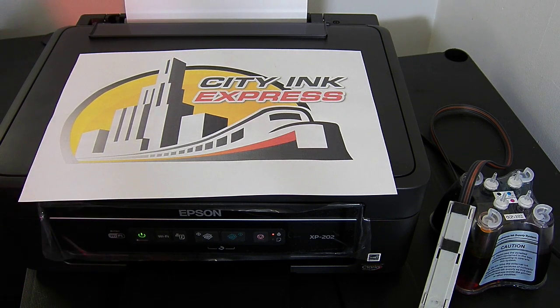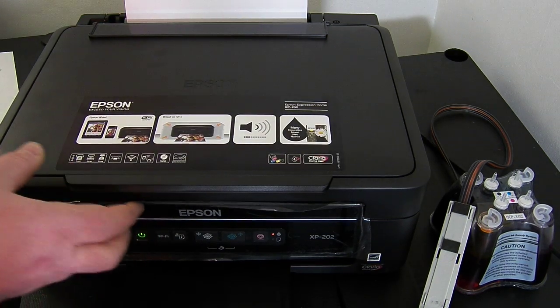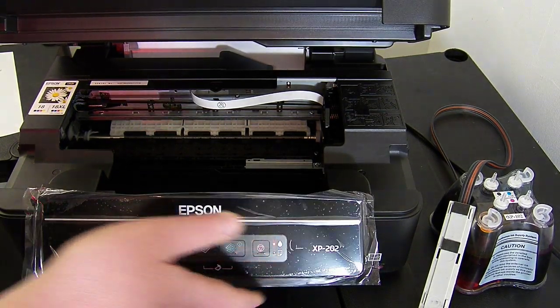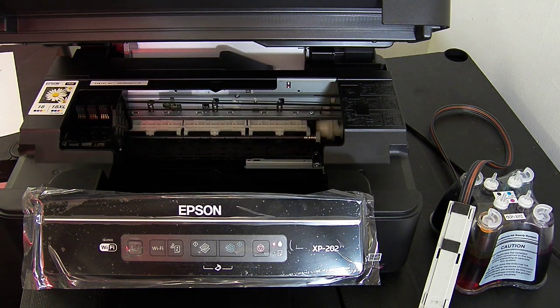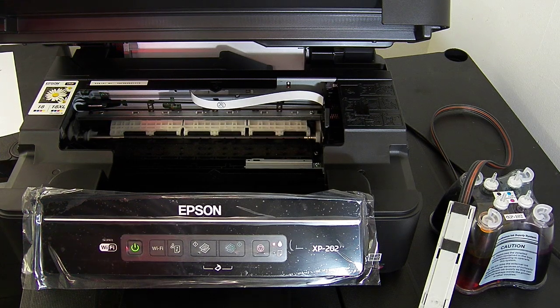The fit method is the same as the XP205. At the moment I've got the printer powered on and there's no ink cartridges in it, but I'm going to press the ink cartridge change button to get the printhead to come over to the middle. When the printhead comes over to the middle you need to power the printer down at the wall.